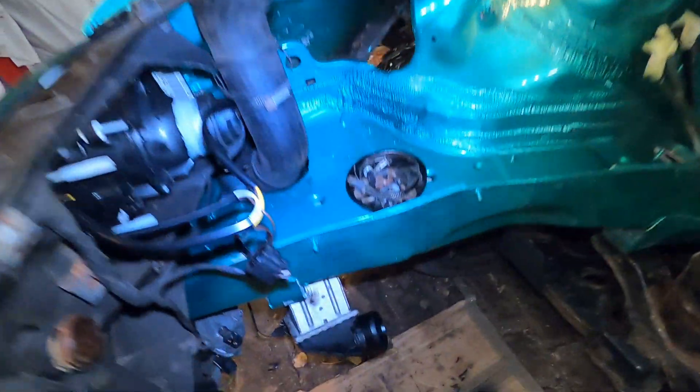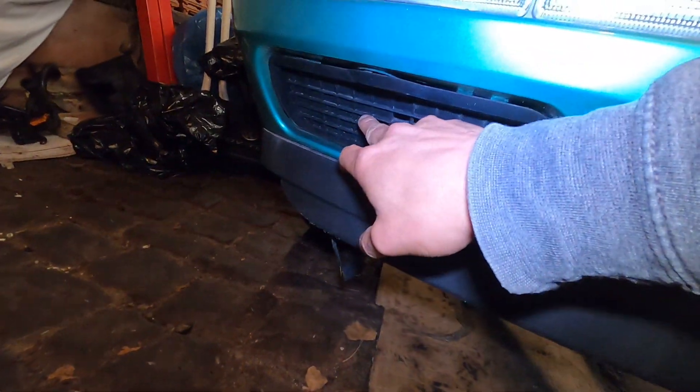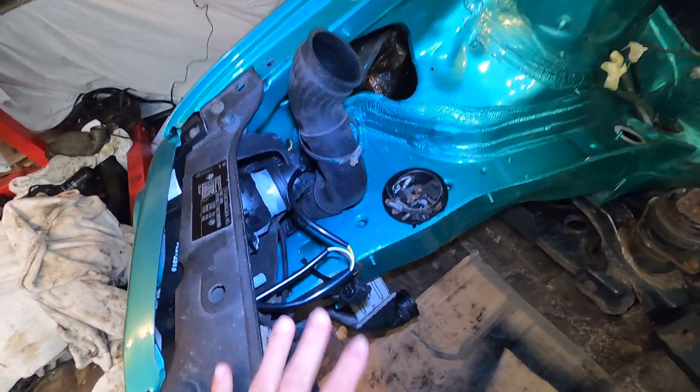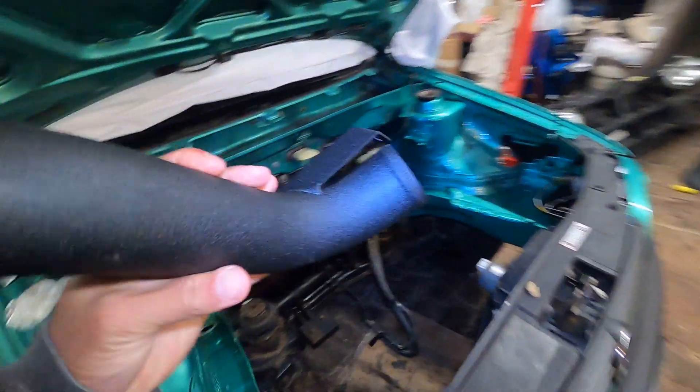He said there's never been a cooling issue. There would obviously be more cooling with a bigger front mount, but if I can beat this car no problem using the factory side mount and make it all work, that'd be dope. So I'm leaning back towards that route. He said it works no problem, no issue. I've showed this a hundred times, but that's where the factory side mount sits in a Mark 3. If I keep it there, I might clear the side and cut the vents for better airflow. With this car running less power and less boost, I think we'll be okay.